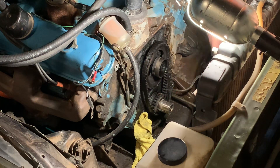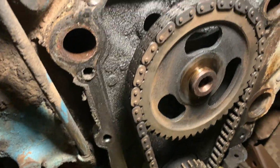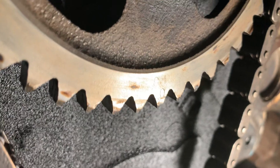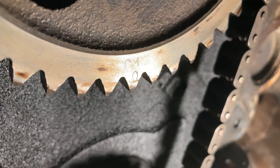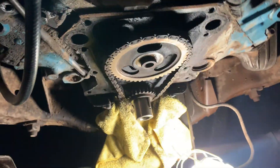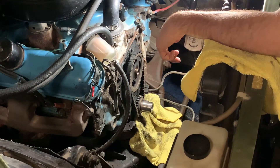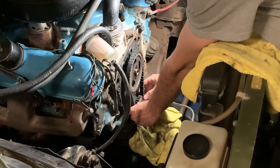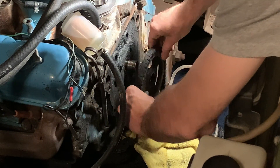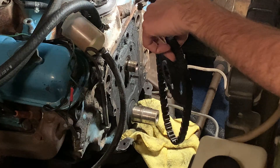Bear with me — I'm using the little remote starter. I had to clean off the camshaft sprocket. If you see at the very bottom, it has a little tiny mark that says zero. That right there is what I had to line up. The crank sprocket has a little indentation there — that's supposed to line up with it. You basically want to get those two marks to line up before you take off the timing chain. Putting the new one on, you have to be a little careful. This old one should just slowly work its way off the assembly. And it comes undone — I'll grab the crank sprocket as well. The timing chain is now off.